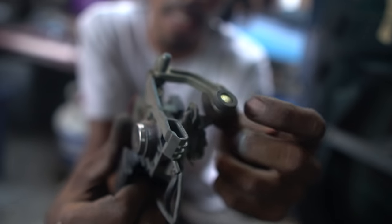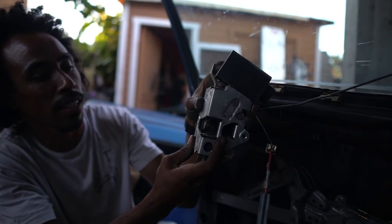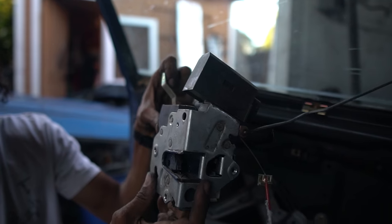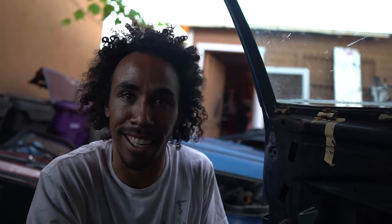In my case on the rear of my '92, that grommet wasn't there — it was too old and broke off. I'd try to open the door and it wouldn't open, just not registering, because when the linkage was like this it would just get hit a little bit, and with the grommet it gets a little more movement and then boom. I really don't know how much I know about these cars — it's just stuff I had to deal with.